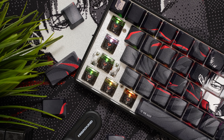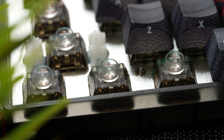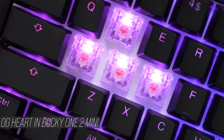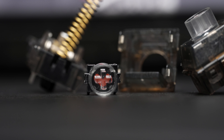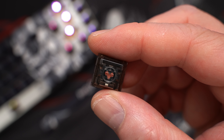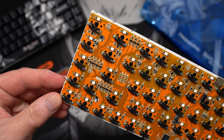Under the caps, the Gateron reds are no more, and instead we find custom colored versions of the TTC Heart switch. Mind-blowing. The TTC Heart is a really solid stock switch that we've looked at before on one of the Ducky boards, but with a smoke gray housing color that they're calling the Titan Heart. It's tough to capture on camera, but these actually have a little plastic heart captured in the stem of each switch. This is a big level up. These don't need lube — they sound and feel great. Awesome to see. The board is still hot swap should you wanna change these out, but you really wouldn't want to.